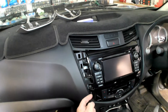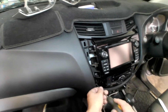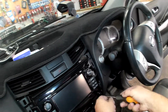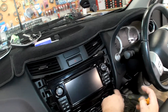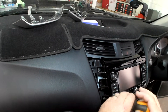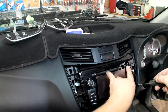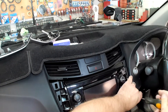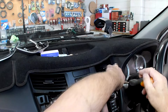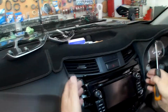These pieces are clipped together — there are clips on the side to hold the two as one. It's generally easier to take the whole unit out in one go. There are six screws in the plastic: two holding the climate control down the bottom and four holding the radio. Now there are slight variations of these radios in these cars. Sometimes this is just a trim piece and the radio sits behind it, a lot more rectangular like you'd expect. If that's the case, removing the plastic that I'm doing now will separate the radio from the fascia, and then that would just pop straight off.